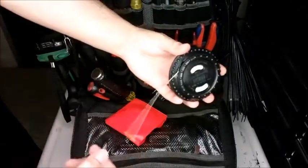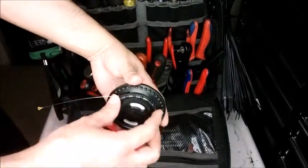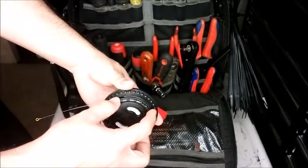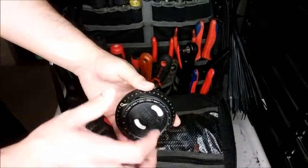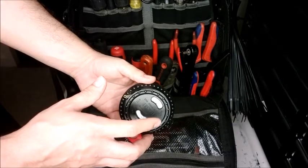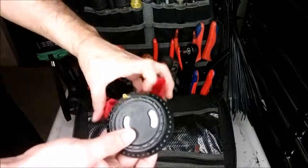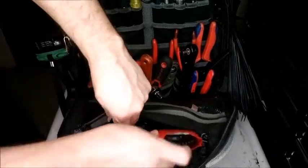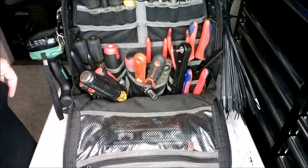It measures the vibration of a unit running, and it gives you an approximation of how fast a motor is spinning. It's really useful in front load washers to diagnose if the motor is going out, if it's not spinning very fast. And on occasion, it's really helpful on a compressor for a refrigerator to get an idea if the motor is going bad based on how fast the motor is going. Because if it's not cooling and the compressor is revving really, really fast, then the check valves might be bad, and so it's not moving coolant.